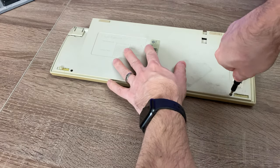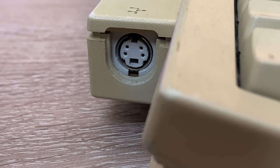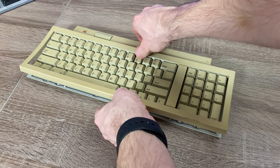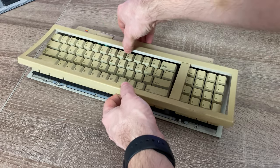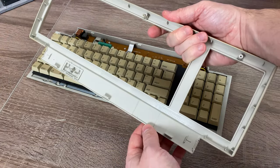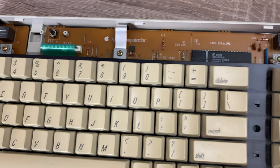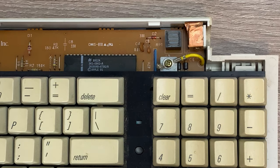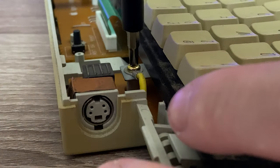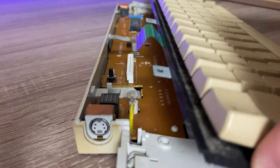To get into the keyboard, there are three screws in the front, and the back's held in with some plastic clips. As you can see, someone's clearly been into this one, which is never a good sign. And clipping these things is always a bit scary as the plastic tends to get brittle. You can see how yellow these things have become. The keyboard itself is held in with another three screws at the top, connected with a ribbon cable, which is held in by a plug that just pulls up and the cable comes out.